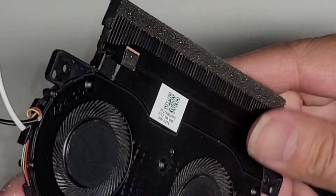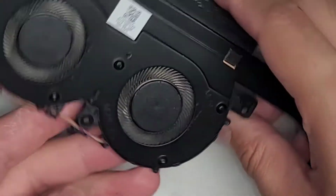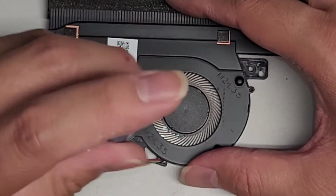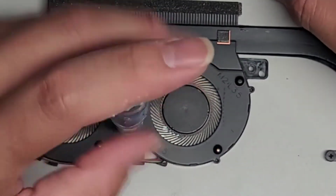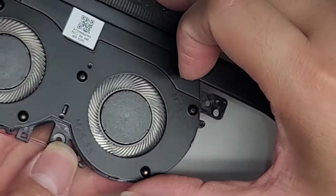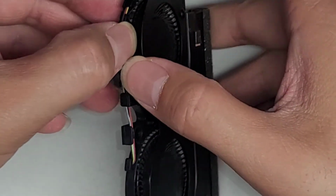All right, I have to check, make sure that these cables aren't going to prevent me from pulling this out. So I'm gonna try and lift here. Oh, I missed one screw. Sorry, there's another one down here. So there's actually 7 screws in this thing. Move this one slightly over. Okay, so there's actually 7 screws in here. All right, now let's see if we can lift this. Did I miss any other screws? It looks like we got them all. Okay, so now you can see this plastic is separating from this metal piece.